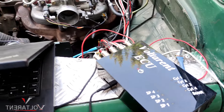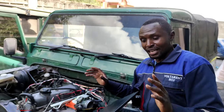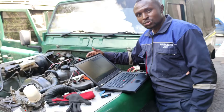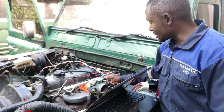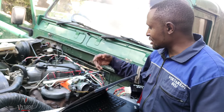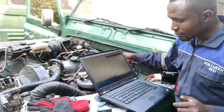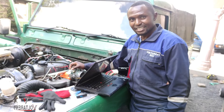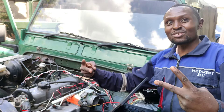What is left now is to tune it up. Of course I need to tune how it starts — the ignition angles it needs during cold starts and acceleration — to prevent hesitations and surges. Ideally when you floor it, it should rev up very fast, but those are parameters I need to set. That's where the tuning comes in. I'm happy, you're happy — now we can proceed to the next step: wrap up this harness and let's make this beast hit the road with tuning. Thank you guys.